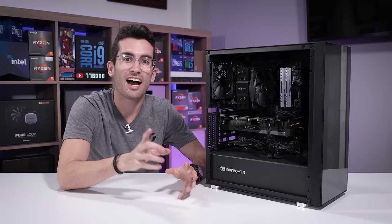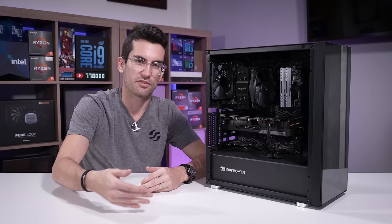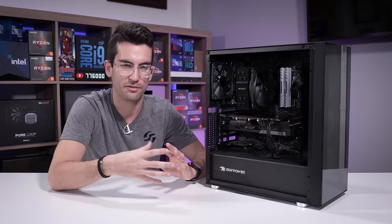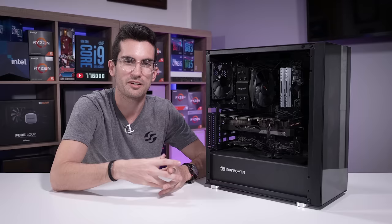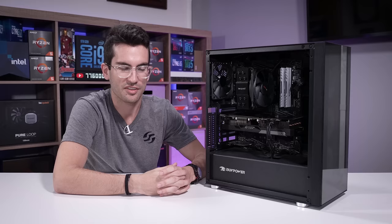If that's something you're open to, I would totally pay for shipping and just disassemble it here on the channel to try to get a good list of what AIOs are doing this — document the color of the fluid, the type of buildup, how nasty it was given its age, et cetera. I'd like to put together a little catalog for that and maybe give it out to the vendors and manufacturers moving forward to ensure this stuff doesn't happen again. It's just a shame because I don't want people to be afraid of AIOs. Obviously there are a few extra failure points that these trusty old tower coolers don't experience — that said, they are still plenty viable. They look really cool and they can keep your CPU nice and chill.